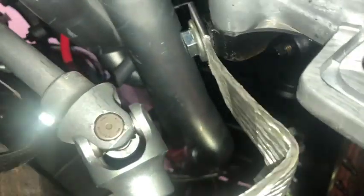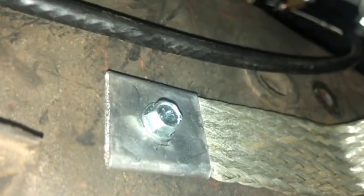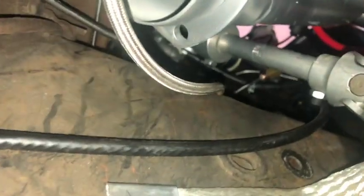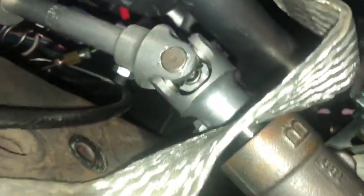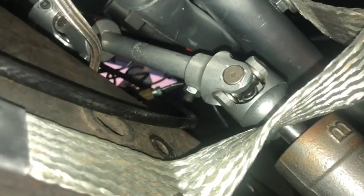I ran a ground strap from the engine. I'm a big proponent of grounding the engine. I know you're grounded with the bolts and engine mounts a lot of times, but this grounds it directly to the frame rail — I think you just can't beat that. The reason I ran it how I have it here is logistics — I had to be able to get my drill in this spot with the transmission over there, so that was the only place I could really get to. It looks like it's on there with room between the two, and it's not really going to move much anyway, so it should be in good shape.